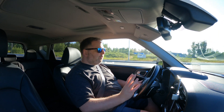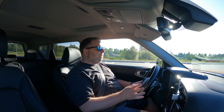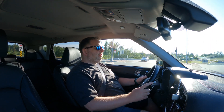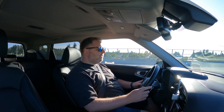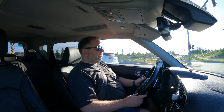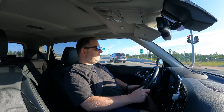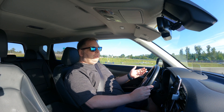The battery is as conditioned as I can get it. I've put winter mode on even though it's hot outside — it's 22 degrees outside right now — and the battery is at 24-25 degrees, which for this car should be good enough to start charging pretty fast. My only issue is that I have a pretty high state of charge, around 30-something percent, but that should be enough to get at least a little bit of the max speed on the old Kia, which is around 70 kW.